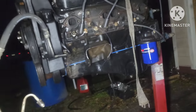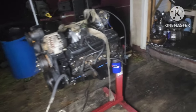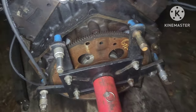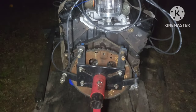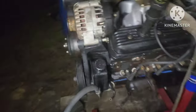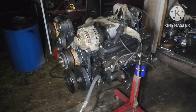Out here late-night grinding. I gotta change this flex plate — I got another one. A couple of the teeth are chipped on this one, that's why I was just using it as a test piece to crank the motor over. This is the 350 Vortec with the Summit 8802 cam, which has pretty much the same specs as the LT4 cam, so you can call it that.